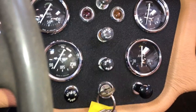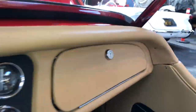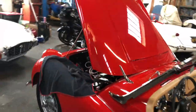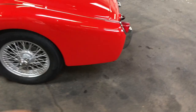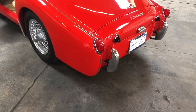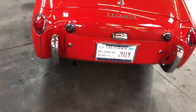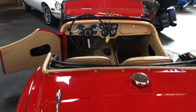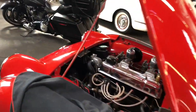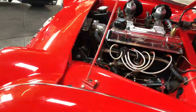Let's walk to the back of the vehicle here and take another look at the exhaust. Make sure it's still not blowing out any black, blue, gray, or white smoke. I can see a little condensation, but so far looking good. Just like before, I'll let it idle for about 15 or 20 minutes while I shoot the rest of the interior and see how it does operationally. Fender cover on — so let's go into the engine bay area.